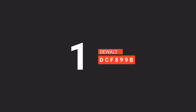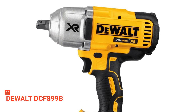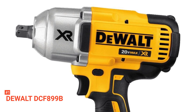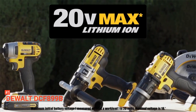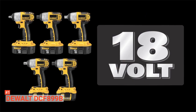Finally, our top impact wrench is the DEWALT DCF 899B. This brushless high torque impact wrench deserves all the hype and attention. Designed with various features, DEWALT DCF 899B has a heavy-duty impact mechanism with maximum torque at 700 feet-pounds and a breakaway torque at 1,200 feet-pounds. It has a half-inch detent anvil that features a brushless motor design to provide superior runtime, performance, and durability. The detent anvil pin offers quick and easy socket changes, retaining the socket to avoid dropping it.